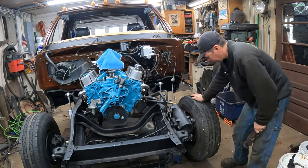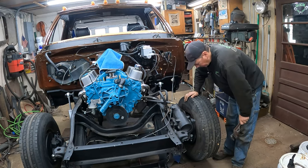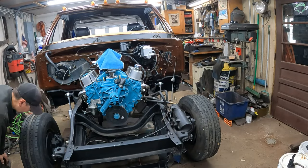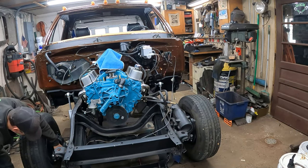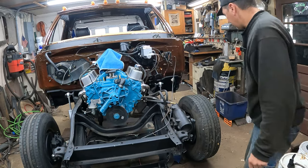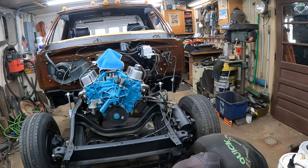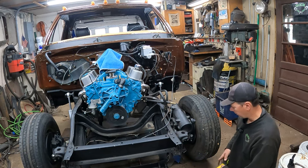This is going to screw up the back and forth of the steering wheel because essentially it's steering the wheels this way and steering them that way. I kind of wish I didn't realize that because I set the cotter keys and everything. The coarse thread on this side — I don't like that at all. Why would they do that? I'm going to have to knock the tie rod end out. I'm going to put a round in that side because this side's finer. We're still 67 and still toed out like an eighth, obviously, because all I'm doing is shifting the front end back and forth.